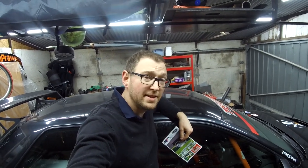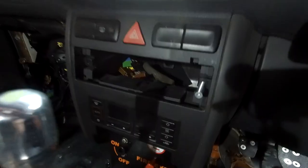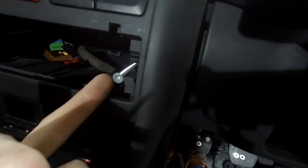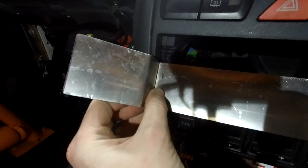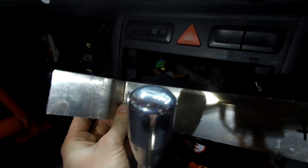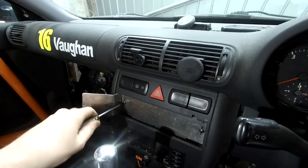And anyway, back to this timer mount. So what I've done here is a little bit pikey. I've put a bigger screw in to carry on the line of it, just because those screws aren't perfectly square to the plate. I can then offer the plate in, mark the height that it's going to sit at, offer the plate up underneath and mark the line. Now, I've done the same on this side to mark that line. Height-wise, I know I want it to sit square, so I'll mark it the same as this side. Over here, get that drilled, that'll be ready to screw in.